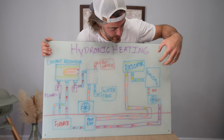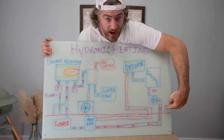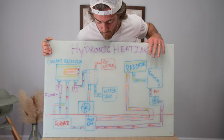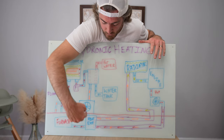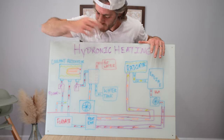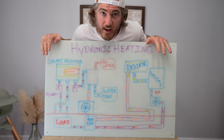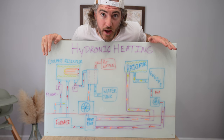The third way to heat is via the engine. When the engine is running, we take that hot excess heat from the engine all the way to the back of the van where the heat exchanger is, and our coolant loop exchanges that heat by running in opposite directions through the heat exchanger. I hope that helped — let's go into the van and I'll show you it in a real-world use case and show you how I put everything together.